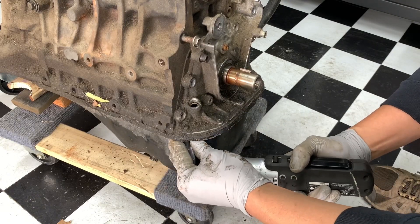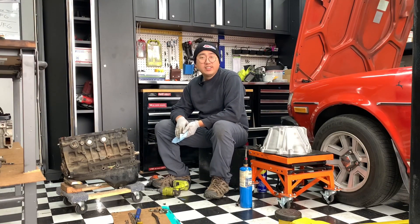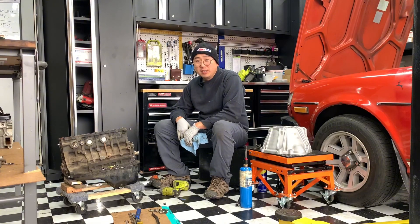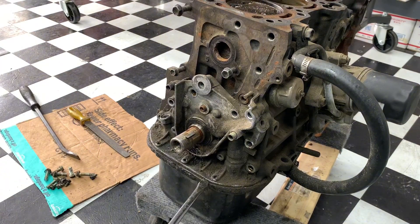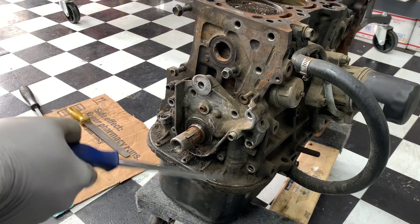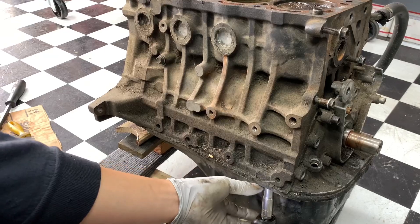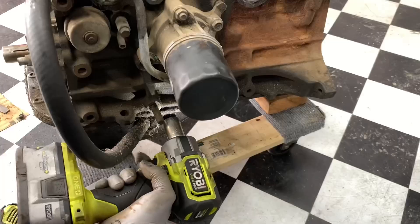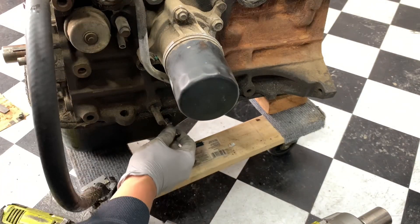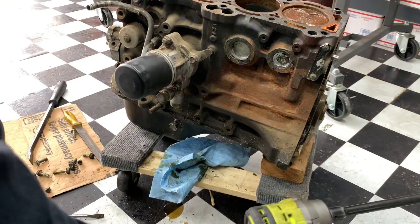You're probably wondering why I don't just throw it on the bench upside down and take it apart. Well, there's still oil reading on the dipstick, which means there's a lot of oil in here — if I do that I'll make a big mess. The backing plate broke loose, and the pan needs to break loose too. What's holding it in is the oil pickup, which might be two bolts to the pump or two bolts and a bracket to the block. I'm just going to take off the pan bolts. We only had one crush washer, so someone's messed with this before.